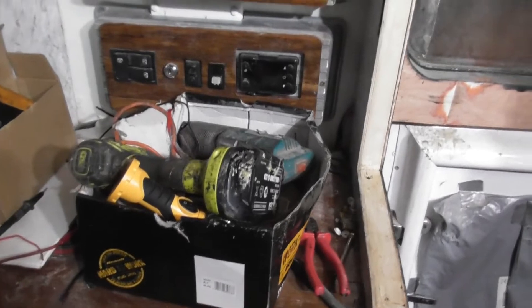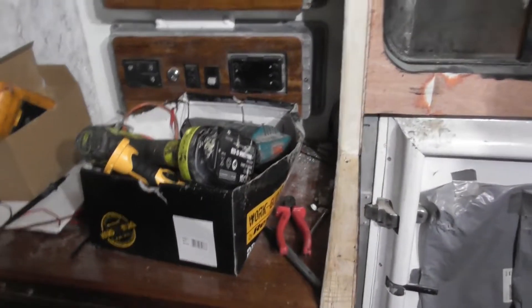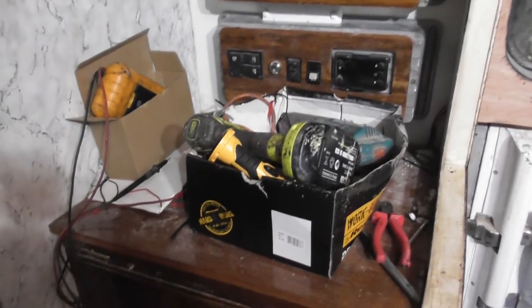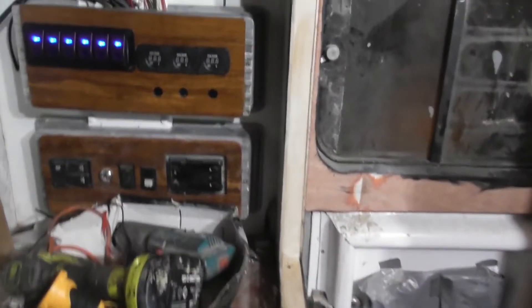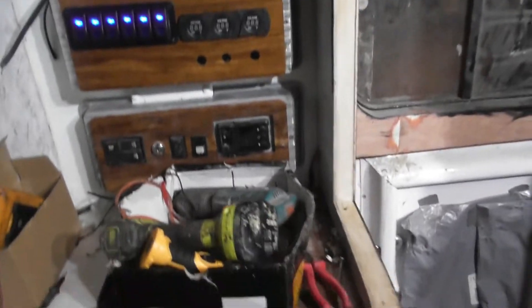They'll all be linked to the one power line going in, but I can flip between each battery. I was going to wire them all at once but there's a lot of amps buzzing through that lot if you get a wire issue. Plus on the roof there are solar panels still to wire in. We've got the stereo to put in, a light switch to go over there where the orange wire is, and more lights to add.